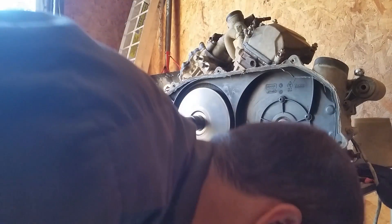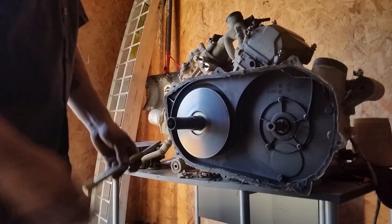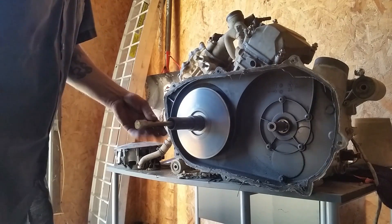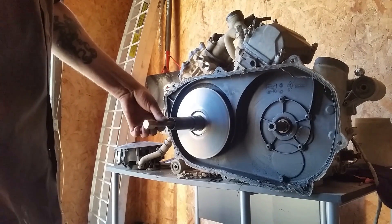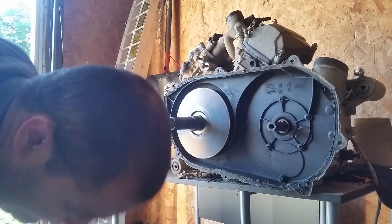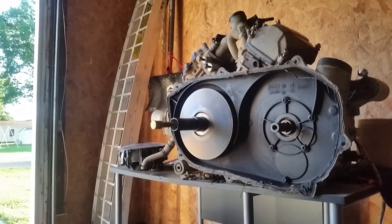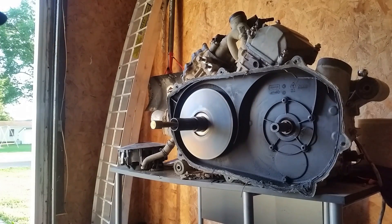Inspect your helix, make sure it's okay. You're going to need a puller — it's a PCP16. Just want to get it started in here. I believe it's a 17 millimeter too... no, it's a 19. 19 millimeter socket.